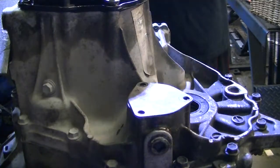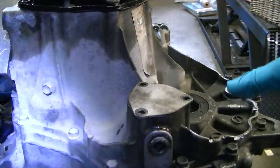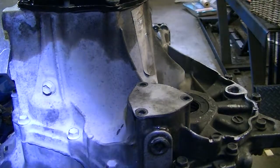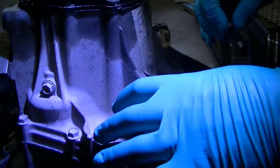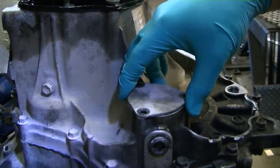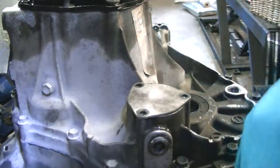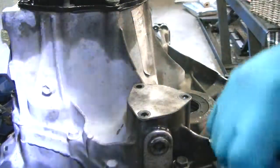Alright, if you had — obviously I've got this transmission tipped up on its side — but you can only get second and fourth, or no, I think that's the combination. All you've got is your selector cover here; it's got three 10mm headed bolts in there, just take that off.